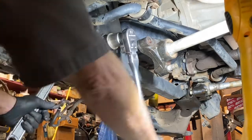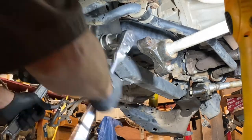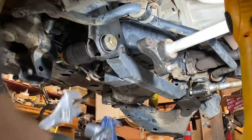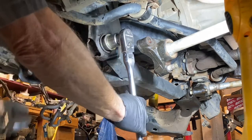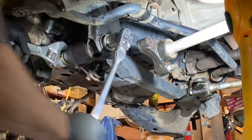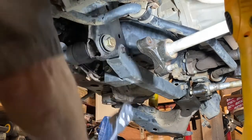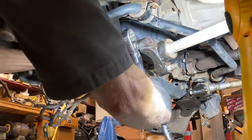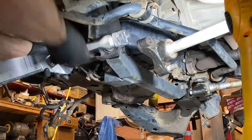I think I might be able to put my ratchet on there now to speed it up. This bushing — I'm telling you — it was frozen in there. I've been hitting it with my air hammer as well, vibrating this end, and I put a lot of pressure on it before I broke that threaded rod. You've got to have a setup that has no flex whatsoever. That threaded rod stretching — I just lose out to the bolt.